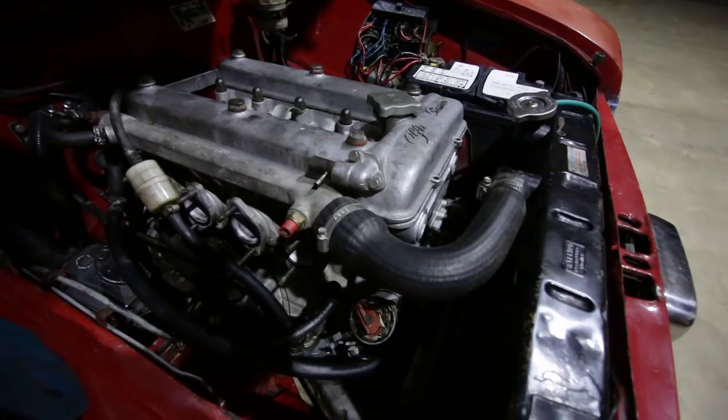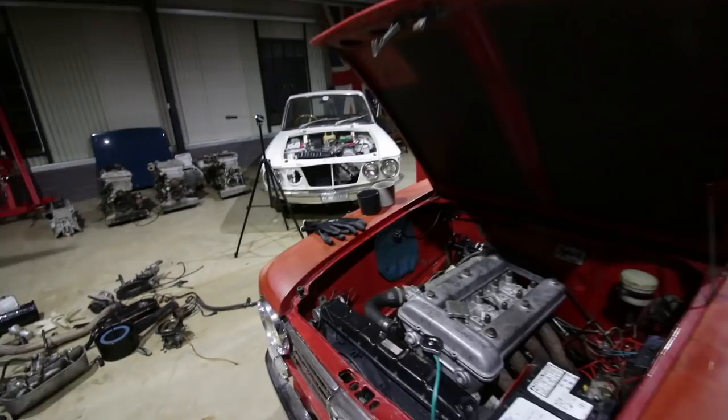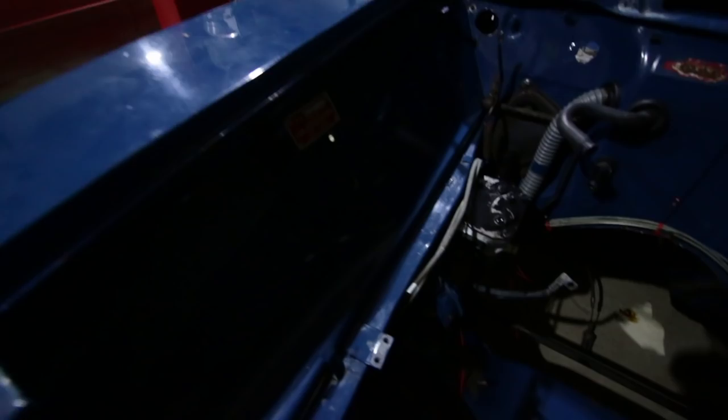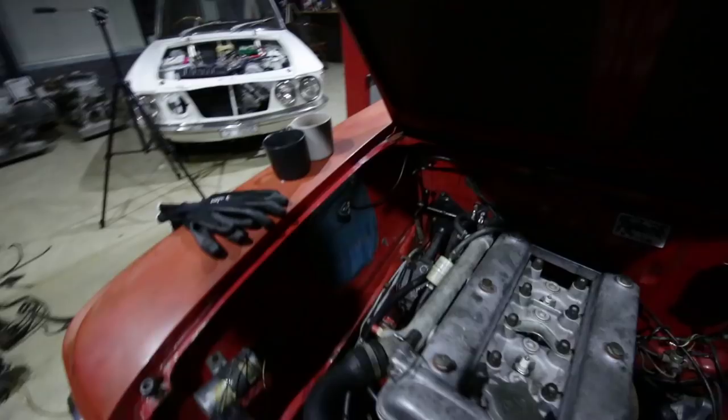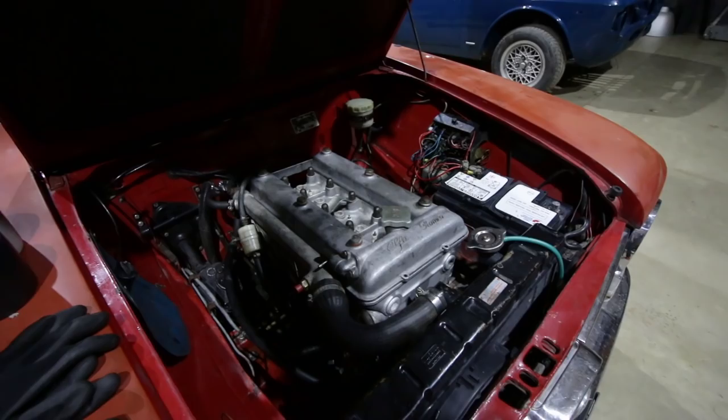However, the big thing is going to be finding somewhere to mount a fuel pressure regulator, because these side drafts definitely need it. You can see on most of them they have this little plate in the engine bay where your pressure regulator bolts on. This car doesn't seem to have anything. So I'm going to work that out in the morning. Obviously, that's going to be done before the new carburetors can go on. So plenty to be getting on with. I'll pick this up in the morning.